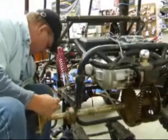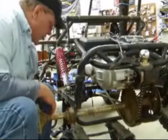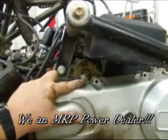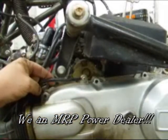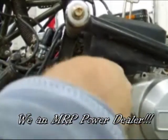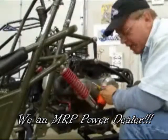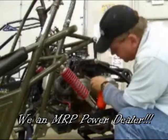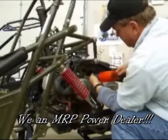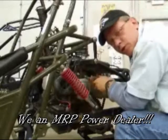That makes eight — so there's eight bolts that you've got to take out of the CVT cover. After you get all eight bolts out, you'll also notice that there's a Phillips head screw with a cable attached to it. You'll need to take that off as well. Now this screw is being a little bit of a bear, so I'll show you a little trick. When things have been sitting in there for a while, get the proper size screwdriver and just give it a couple of taps. That usually loosens them up for you.